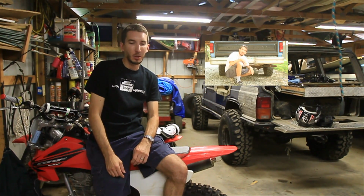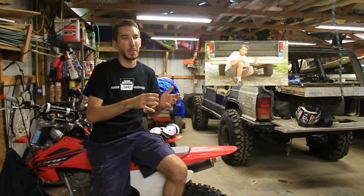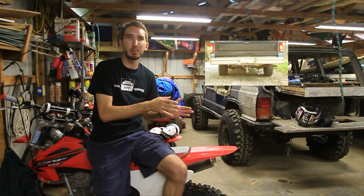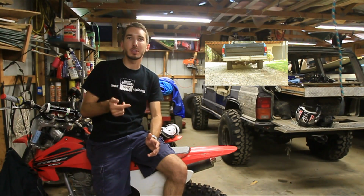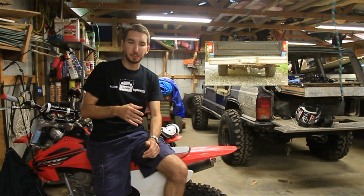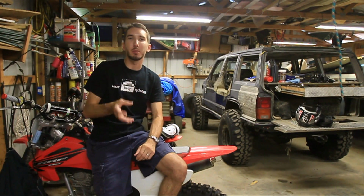Now in that video, what I did was compare the differences between airing down and not airing down. And the premise was for me to take my truck and I aired up one tire to 30 pounds and I aired up the other side to 5 pounds, and I parked it on a hill, spun it to see which would spin first. Obviously the higher the PSI is going to spin first because it gets less traction. The lower the PSI is going to get more traction. Now, obviously we know, unless you're crazy, that the lower you air down your tires, the more surface area you get, the more traction you get as well, and the better it grips onto the rock.